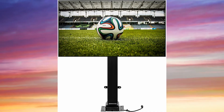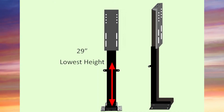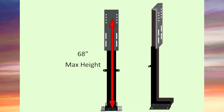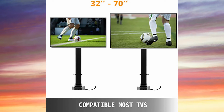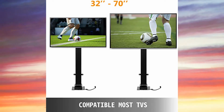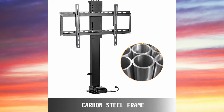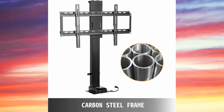For this project, I used a Weaver motorized TV lift, which I call a Televator. It has a stroke length of over 39 inches, which is ideal. With the lift collapsed, the TV will stow completely within the enclosure. I have plenty of travel to extend the TV above the height of the enclosure with a few inches to spare. The TV lift can hold TVs from 32 to 70 inches and has a weight capacity of 154 pounds. The Weaver TV lift is available on Amazon, and the link is provided in the description below.